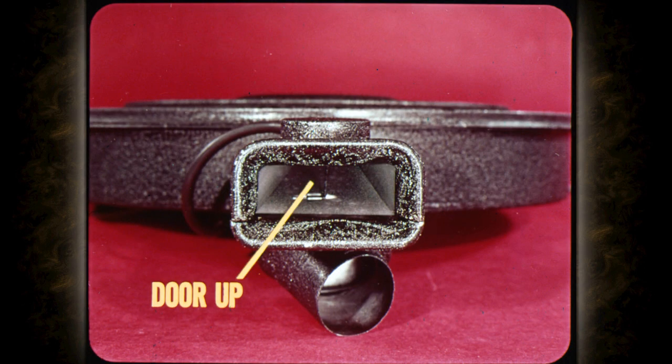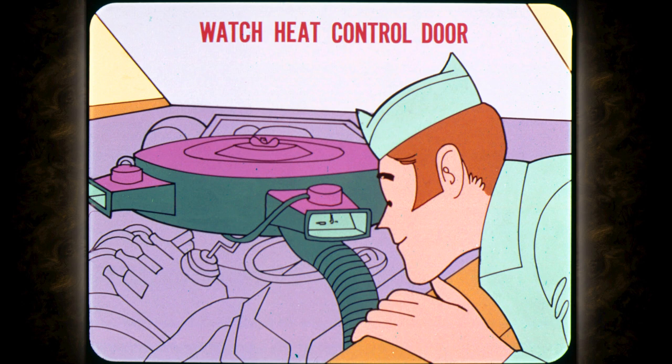You will probably never get to check a cold engine in the service garage, but if you do, with the engine cold and an ambient temperature under 90 degrees, the door in the snorkel should be all the way up or open to full heated air. Remember, the engine has to be running to provide vacuum at the diaphragm. The exhaust manifold starts to heat the air almost immediately, so watch the heat control door to see if it has started to modulate the amount of heated and underhood air. Warm the engine, including the cooling system, up to operating temperature. At this point, the door should be all the way down for full underhood air.